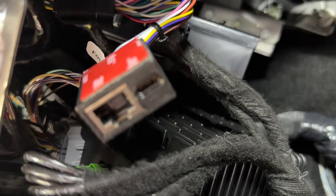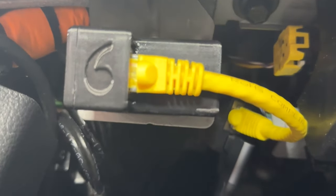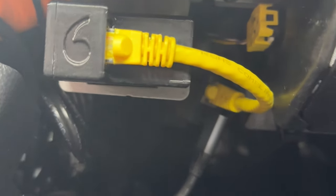Correction — it's not the gray cable; it's the black one above it. The gray cable will plug into the Comma harness, but the Comma harness will not plug in where the gray cable goes, so you have to get the one above it. The Comma power and OBD-2 adapter is on with just a 6-inch Cat5 cable going down to the harness. Most cars have their module up high, so the Comma comes with a short USB-C and a long Cat5 — you need the opposite for an F-150: a long USB-C and a short Cat5. Everything's plugged in; I think it's time for a power-up test.